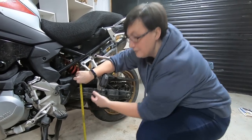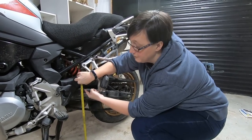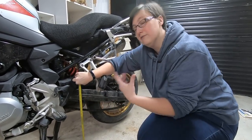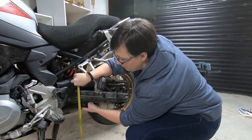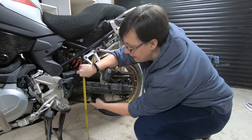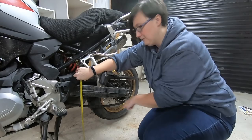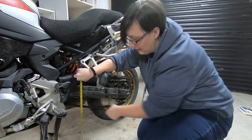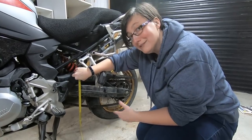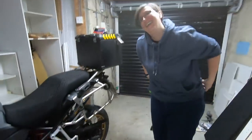A watch out: on some bikes you can see the top side of the chain, so be careful that as you're lifting the bottom of the chain you're not lifting the top part up as well — if you do that you'll get a false reading because you're making the whole chain move. We only want the bottom part moving. The next step is to figure out what your chain slack should be, checking from a couple of points on the bike as you turn the wheel.